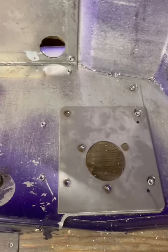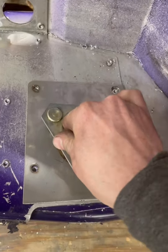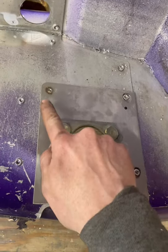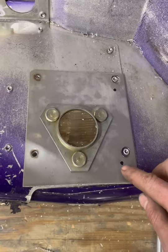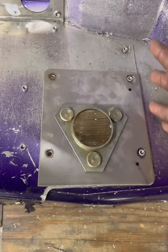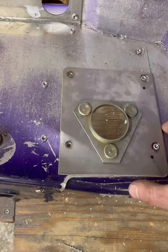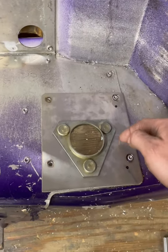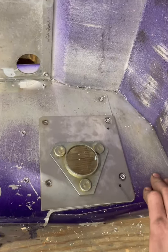To reference the plate, all I do is take the bearing plate and put it in the chassis. That's how I figure out where to drill these two holes — these are going to be our two plate mounting hold-downs. Then we're going to drill two more quarter-inch holes here and here. It's just personal preference — you leave the rivet still in there and everything's good. That's how you do this side, and I'll show you the other side, how we build it back up for where the third stud's going to mount and get it flush.